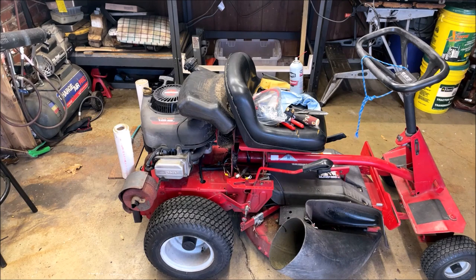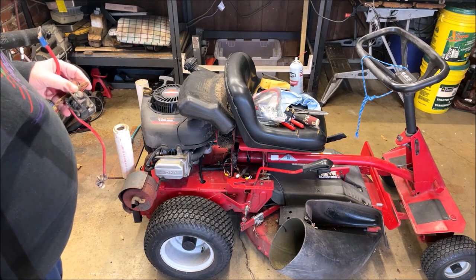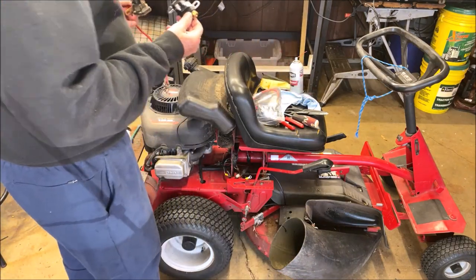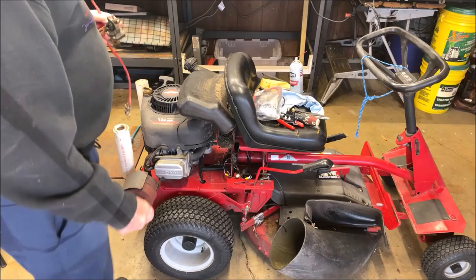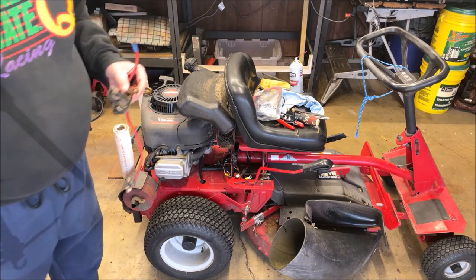But I've got a little bit of work left to do on this thing to get the new solenoid in. The bottom here of the box. Come on, flashlight. Well, the bottom of the box was all rusted and corroded, so I've had to clean it so I can get a good contact on the new solenoid, which is here. Had a three-post solenoid. I'm going back in with a four-post because that's what was available that I could go by. So I'm going back to work here. I've already put some new connections on a couple of the wires, and we'll see how we progress.